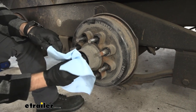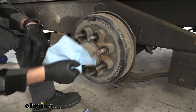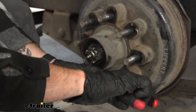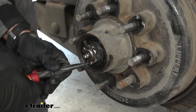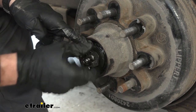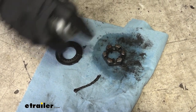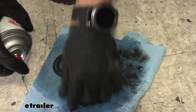Next, I'm going to go ahead and clean up some of this grease and then take out our cotter pin, bend it back, and try to straighten it out. This kit's not going to come with one so you will want to try and save it so that you don't have to buy another one. Next, we're going to take off our castle nut and then our washer. Since we're going to be reusing these parts, I want to make sure I clean off all that grease, so I'm just taking some brake cleaner to spray them down and wipe them off with a shop towel.